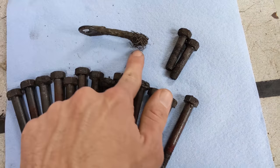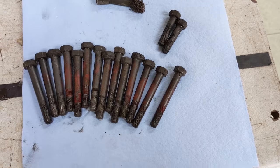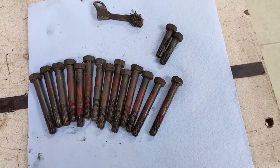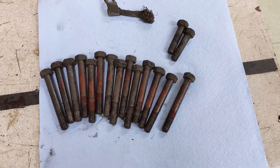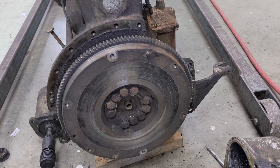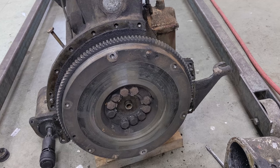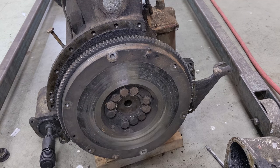Look at the ground strap - it failed a long time ago, so I'll have to get a new one of those. We've got the original starter bolts here. I like reusing all the original hardware, refinishing it - it makes things go back together way faster and easier. Just having a look at the flywheel here. It's pretty heavily grooved, it'll need a resurface. I've got the 10 bolts here on a lock tab, very similar to what we see with the E-types. My dad noticed the pilot bushing is just falling right out of there - that's pretty easy to redo.